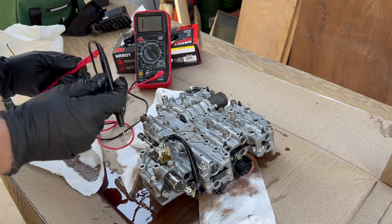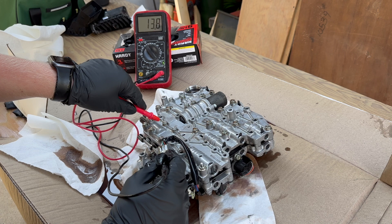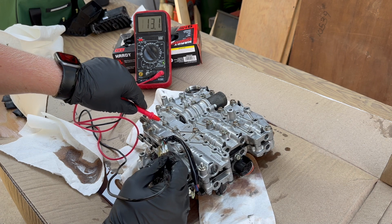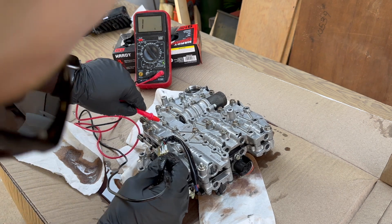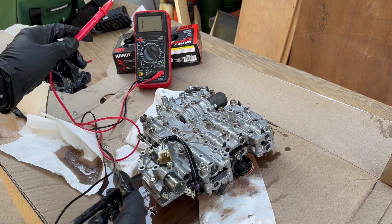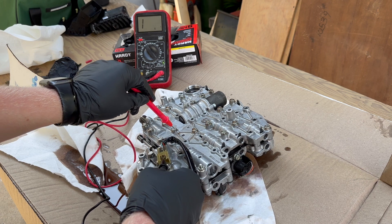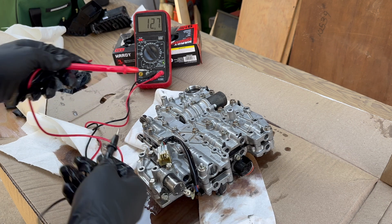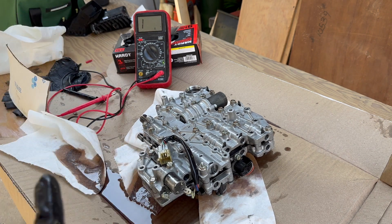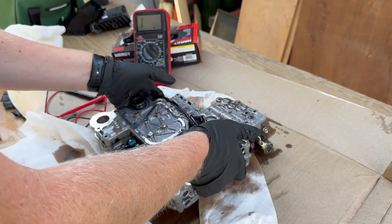Follow the purple wire around — I believe it's this one right here — and I get 13 ohms. These are all ohming out good. You'll have to take my word for it, but when I did this when the transmission was hot, the green wire was at 22 ohms, and the car only starts having issues when the transmission gets warm. Mine wasn't quite that bad yet, but I'm going to replace all three solenoids since I have them.